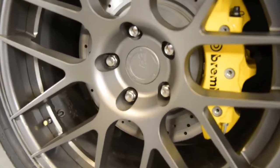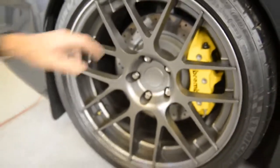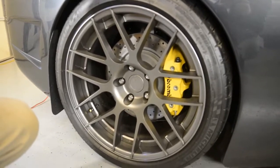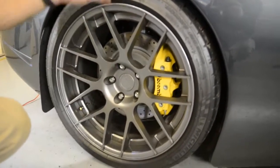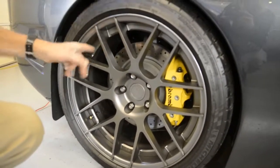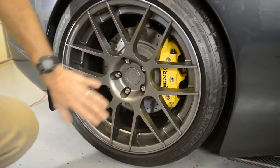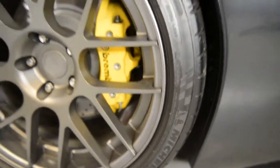Let's talk wheels. These are BC forged wheels. The GTM tells you to use Corvette wheels, but they also have you put in spacers between the hub and the wheel. I looked at a whole bunch of wheels guys were using and none had the correct backspacing — they were all sunk in or too far out. So I found the company, liked the wheels, worked with the engineers, did my own drawings for the correct backspacing, changed the profile slightly and the concavity for the front and back as a matched set. Then I sent my drawings to the engineers and they custom-made these wheels in Taiwan.